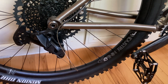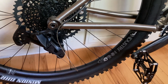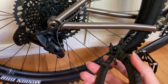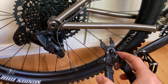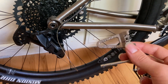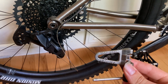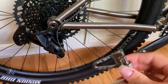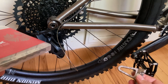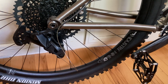Now it's time to do the chain. You'll need the SRAM chain with the master link, and you may or may not need master link pliers — I'll explain later. You'll definitely need a chain breaker tool; if you don't have one these can be around $25–$30, but it's necessary. With that, let's feed the chain on and I'll show you how to cut it to the right length and get the shifter working properly.